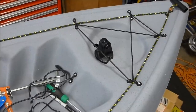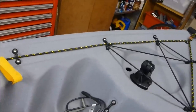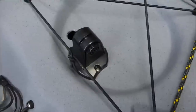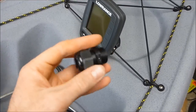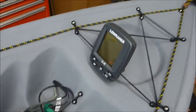The mount for the fish finder is now in place — that worked out fairly easily, no big deal. I just marked the spots and used some silicone and self-tapping stainless steel screws to mount it. The fish finder will clip into place like that. And then I'm going to use one of these tightening grommets to run the cabling through.